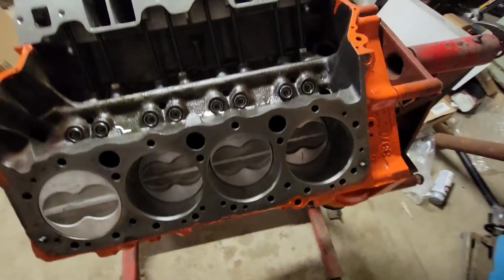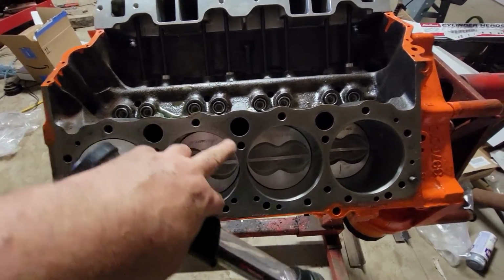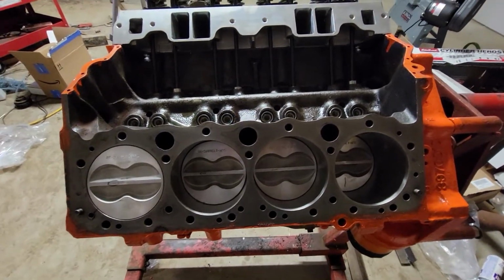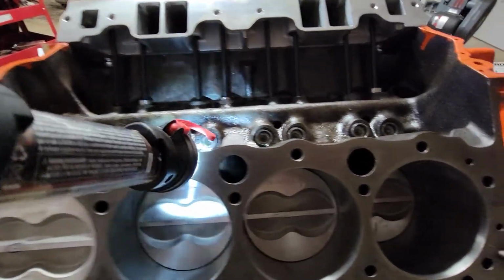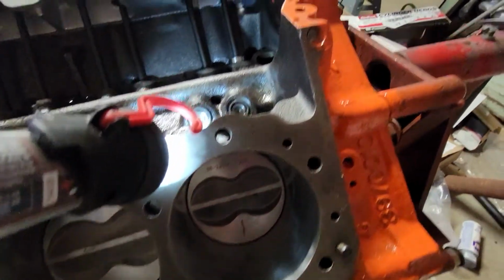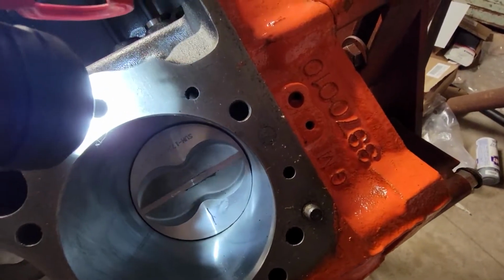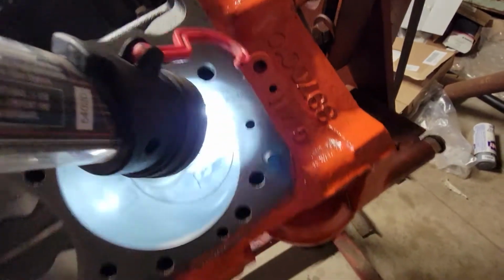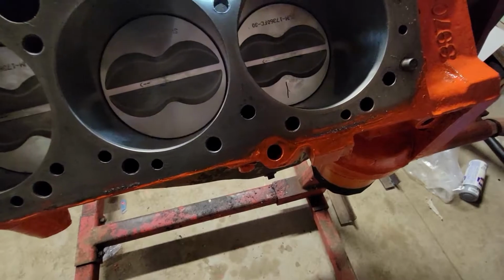Okay, one question commonly asked is, on all your head bolts on a small block Chevy, which ones need thread sealing? All of them. Every head bolt here, as you can see by the light, goes into a water jacket. You get the light to shine that way. You see there, into a water jacket. Every one. Okay, the age-old question has been answered.